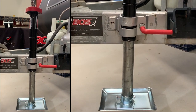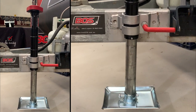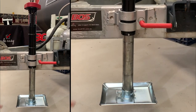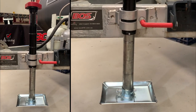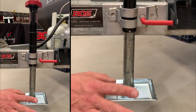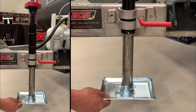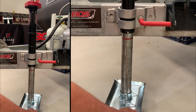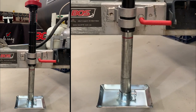This is going to show you what happens if you go past the red line without the clutch engaged — meaning we've forgotten it or had to use drill mode because the drawbar is so heavy. I'm going to do this gently because this will hurt in real circumstances. Going down past the red line — this is where the danger becomes apparent. See how this is now turning? At full force, that will hurt your ankle and do serious damage.